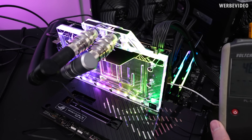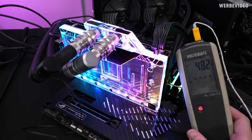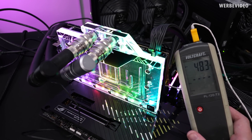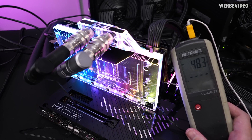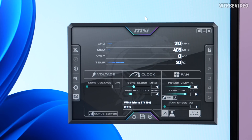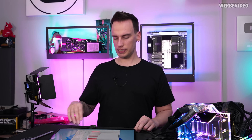I also placed the temperature sensor on the back of the card to check the backplate temperature. It's definitely warm, but it's far away from being hot — I'm measuring the area behind the power stages in this case. There is an interesting thing: if we open up MSI Afterburner, or it could be any kind of OC tool, it's not related to Inno3D, but if we check out the power limit, we cannot pull this higher than 100%.